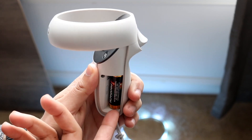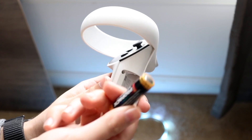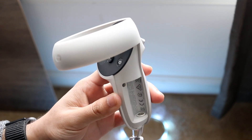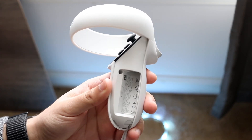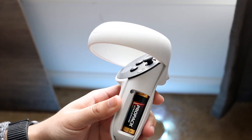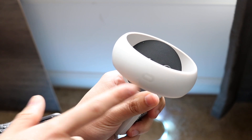You don't have to do anything crazy, you just have to go and take this battery out like this. After you do that, you want to make sure the battery at least has some juice in it — you can replace the battery if you want to. Make sure that inside the battery compartment there isn't anything corroding, and no water inside of it either. Then grab another battery, try putting that original battery or a new battery in, and hold down a button to see if there's a blinking light.